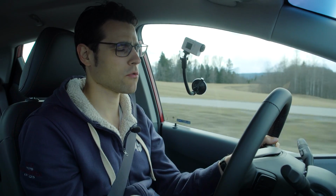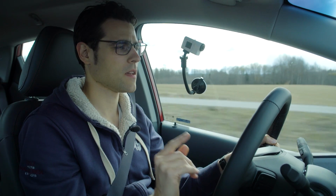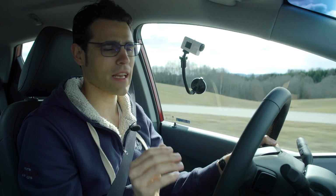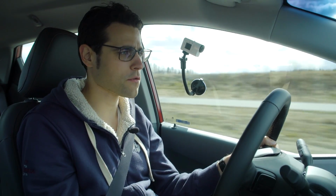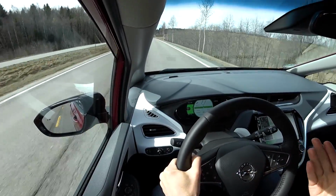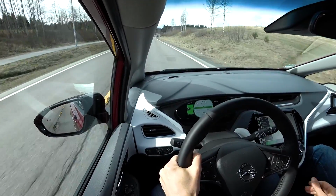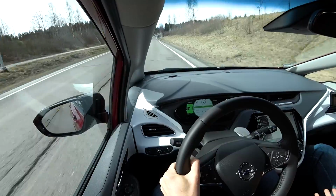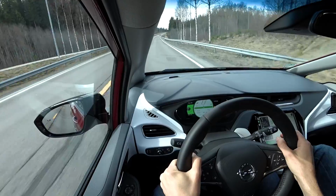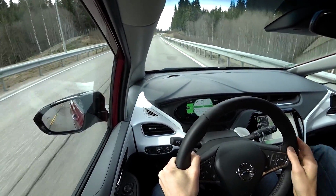Volkswagen with the e-Golf, and the Kia Soul EV, for example, you can also recuperate with the brakes. And the e-Golf is the only one which has this sailing function. If you want to sail here, so no recuperation at all, you would have to move to the N, the neutral mode. That's what I'm doing right now, so I'm only rolling. I'm not sure if you would do that really often when you drive the car. Usually you stay in the D mode, not sure if you want, but it's possible. In the e-Golf you can have a mode where you can sail without going to neutral. Here again, as in the Kia Soul EV, you leave the throttle and have a little bit of recuperation.